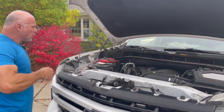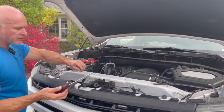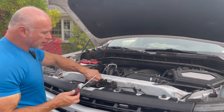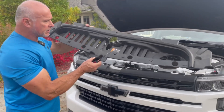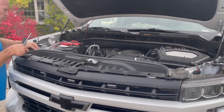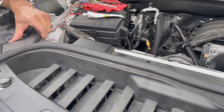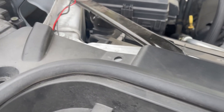That's just what everybody deals with — that's why body shops have boxes of those pins lying around. Now put your grill bolts back in — 10 millimeter, four of them. Once you get them all run down, give them a little snug but don't fully tighten any one before the others. You don't want to torque them unevenly. Then take the center latch back off with your T15, put the intake tray back in place, and run the wires through it — I'll add conduit once I add one more lighting component.